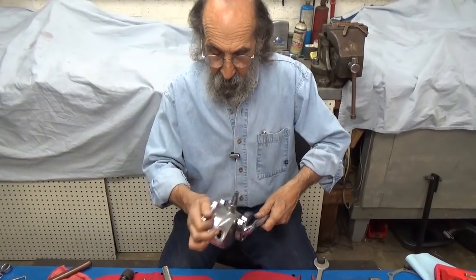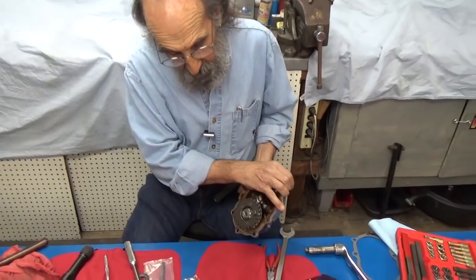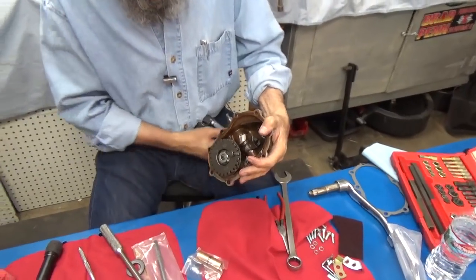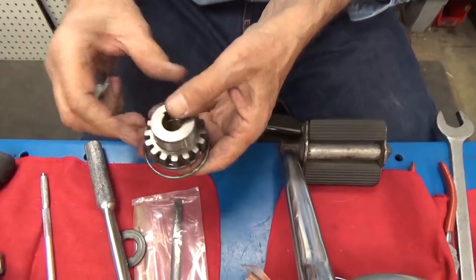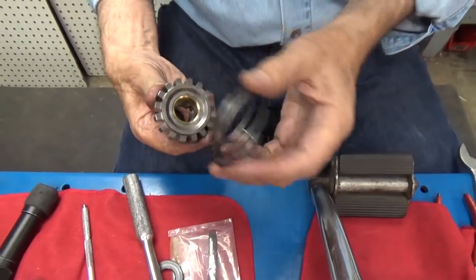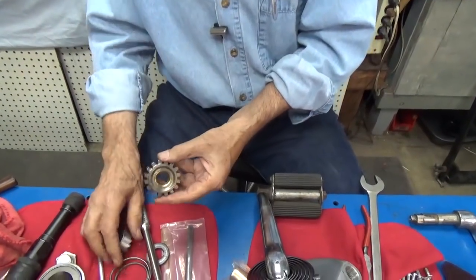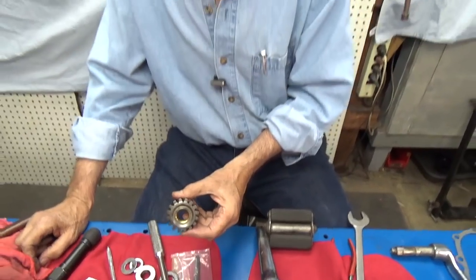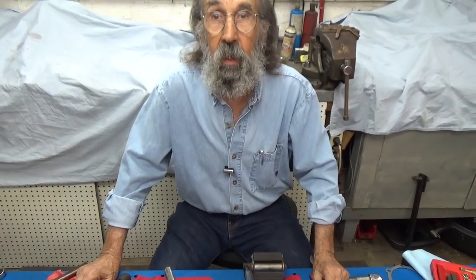Everything appears to be just fine — we're getting there. We have most of this thing assembled. The pin is in the right place. The next thing, which will be in our next video, is we'll put in these little ratchet gears. I went through all I had — some were worn worse than others, but we got a whole new set of everything. I tried this on the main shaft of the transmission and this bushing is too tight, so we'll fire up the old hone, size it perfectly, put it together, and the kickstarter will be done and ready to put on the project bike. See you out on the road — thank you.